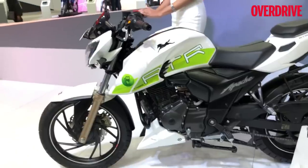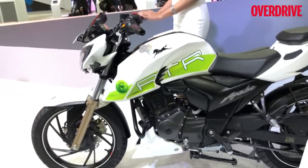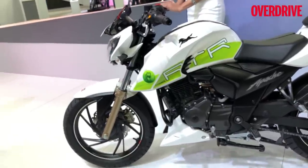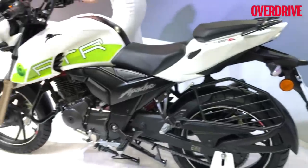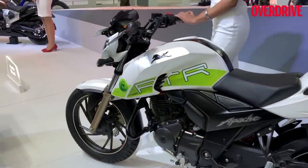He gave us an idea saying if you run an engine at 8 to 9:1 on petrol, you might have to go up to 10 or 11:1 on ethanol to get a similar kind of power. So in the final process, the bike will run very similar to a petrol bike in terms of the performance it makes. But the flip side is you put a lot more fuel in — I don't know what that means for fuel economy, but that's where it's at.